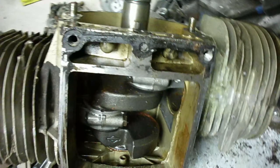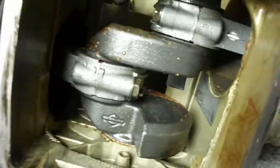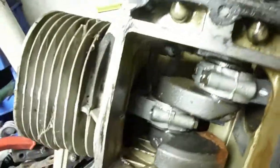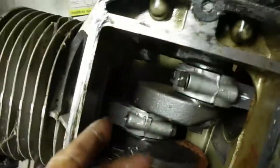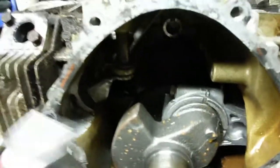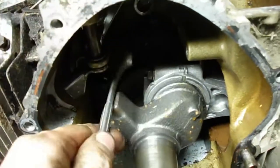I removed the side cover off the outside to get at the connecting rods. You can get at them from the end and from the bottom. I was able to get a socket on the near one and break it loose, but you can't get your socket in this direction, so you have to angle it around the other way. Then you can also use a box end wrench to loosen it up.